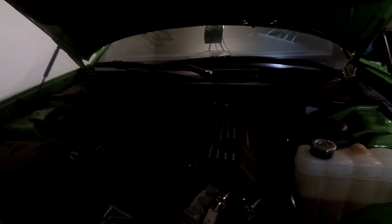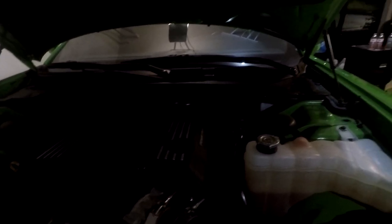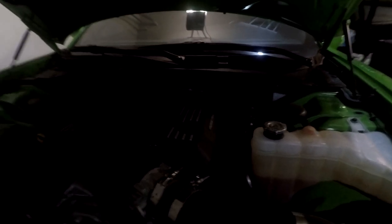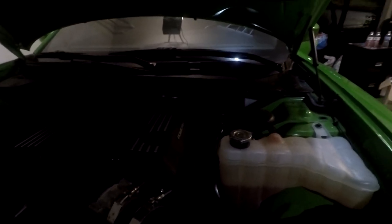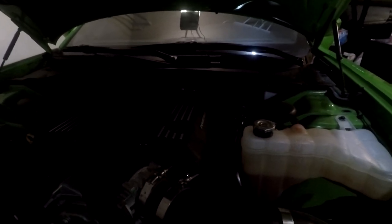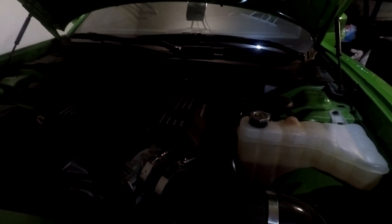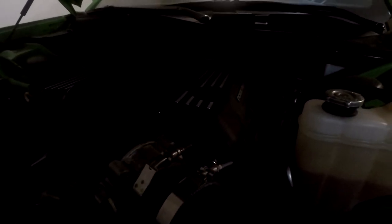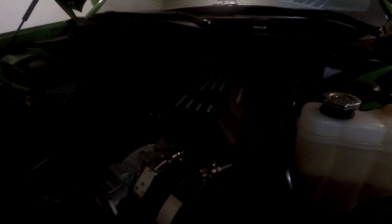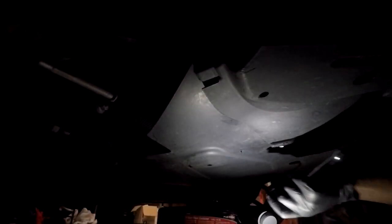For the bottom, I highly suggest you get cardboard or any type of board if you're working in your garage — you don't want to spill any oil because it's a pain to clean up. Get your drain container and everything ready. I also recommend glasses or goggles, and if you're dealing with warm oil, go with the gloves. It's gonna get a little messy down there.